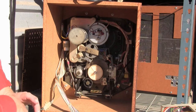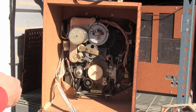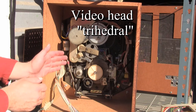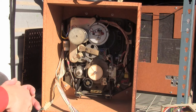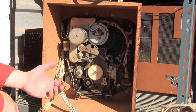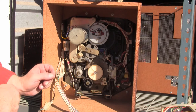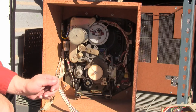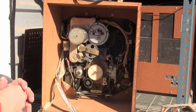On playback, all three heads are engaged — A head, B head, and C head each play the A track recording three times, and then the next track has come around and it does it again. Due to fancy diddling of the head azimuth — they're not precisely on a 120-degree relationship — this results in a slight offset of horizontal sync in the vertical, so that the even field being played three times has a slight offset, causing a pseudo-interlace effect in the television so that the lines of this single field are interlaced with themselves. The horizontal oscillator in the TV never liked that, and that's where you get a lot of flag bending with these.